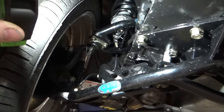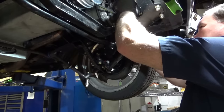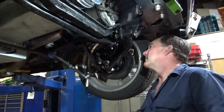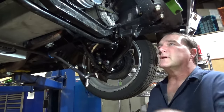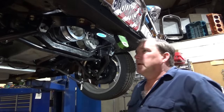The sway bar — it's not being held in position. The sway bar is in the wrong spot. Well, it's in the right spot; it's just in my way. It's definitely better squared in the chassis now though. This bolt galled on me so I'm going to have to cut it out — which is a bummer. I'm going to have to get creative with it. I don't want to heat it up because I don't want to mess up all the powder coat — at least not with a flame wrench.